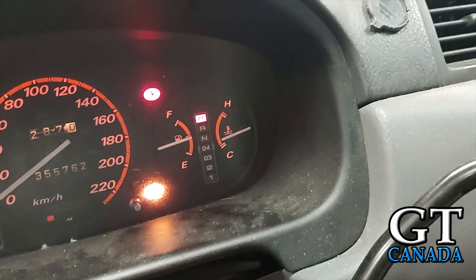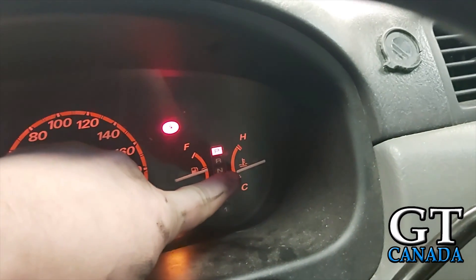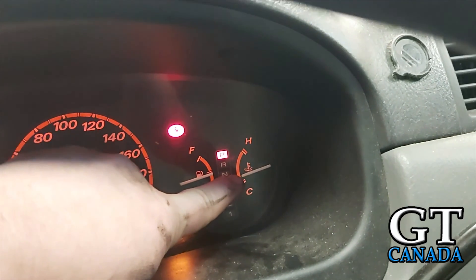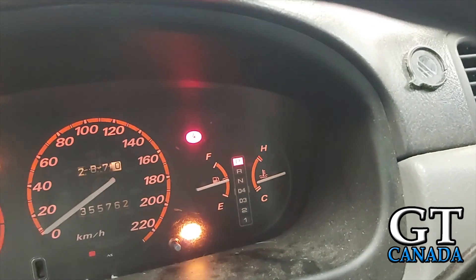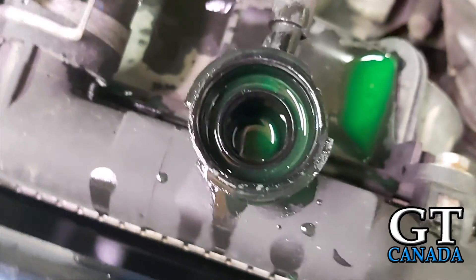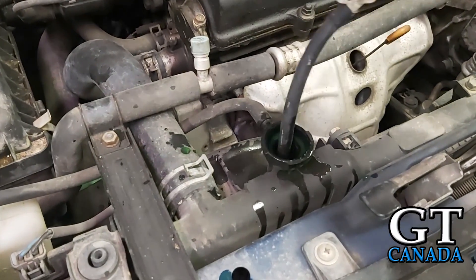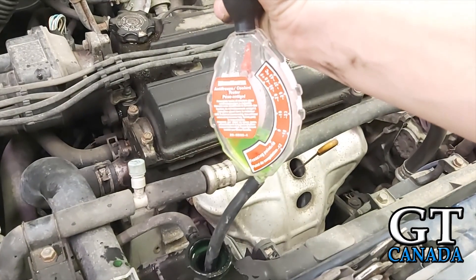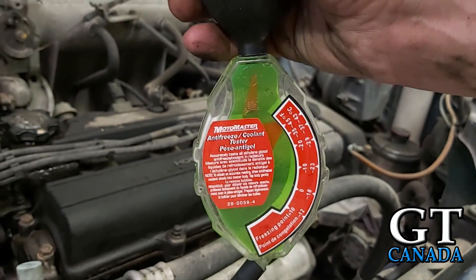Just know that it's bad for animals — you make a smart choice yourself. You don't need me to tell you what to do with it. You'll know when your thermostat's open by looking at that temperature gauge right there. So right now it is off of the cold mark, which is good — that means it's warming up. In a few minutes here it should come up to about the halfway, that's when you know that the thermostat has opened and the coolant is all mixing. You can see how much nicer green that is now. I can stick this in just to get a good idea what I'm looking at here. You can see now it's rated for closer to minus 43, so this car is now good for up to minus 40. I don't have to worry about the engine freezing.